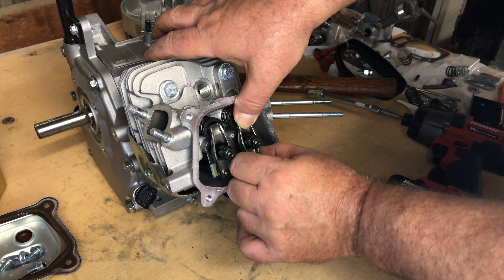I'll save the original 65mm block because there's nothing wrong with it — it came with a brand new piston and rings and I could put something else together with it. This 70mm block cost me 20 bucks. I wouldn't wait too long to look for one after this video goes out. You could also find blown LCT engines on eBay — as long as the block doesn't have a hole in it, you'd be golden and could use your crankshaft and internals in the 70 millimeter block.